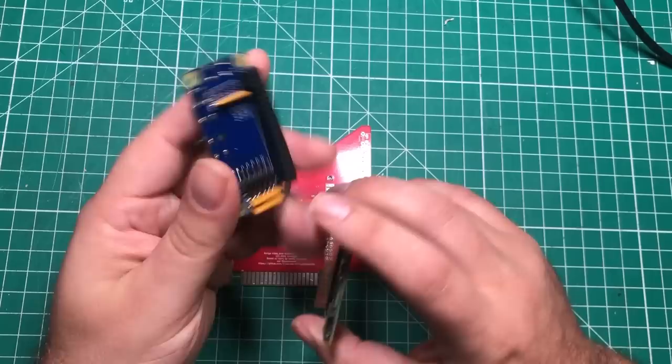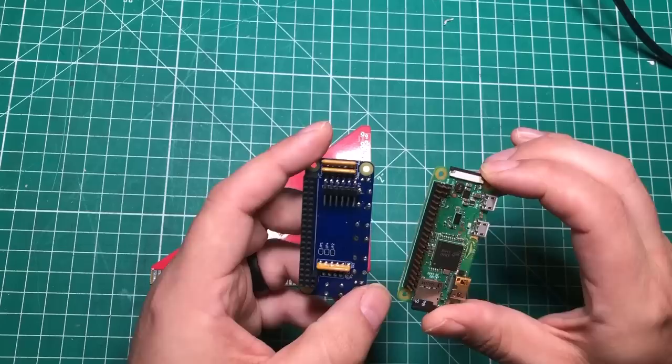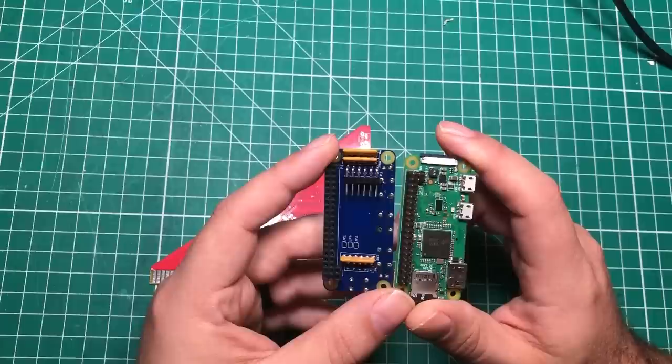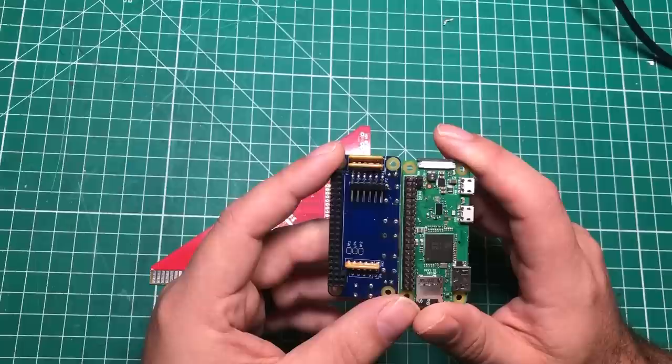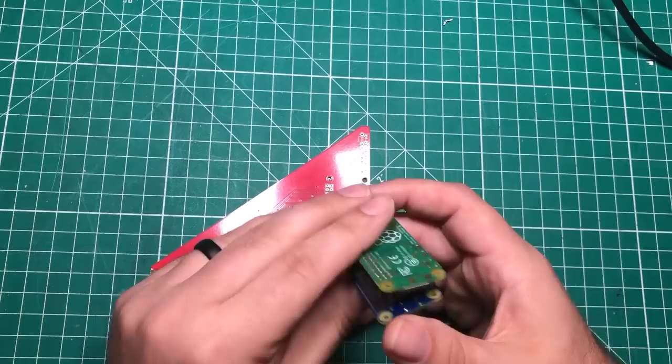So if you're using CGA from an old IBM, you'll make up a 9-pin cable that connects to this and connect that to the CGA port. And it's a little awkward, but it's a very amazing project because those old monitors are dying fast. So, for example, if you wanted the original IBM CGA monitor, I mean, they go for $250, $300. They weigh a lot. They take up a lot of space. They're not super reliable. And they're dying every day. But the idea with this is that you can actually save these things. You can use your old computers on a more modern monitor and get a better picture than you ever would have gotten on the old one.